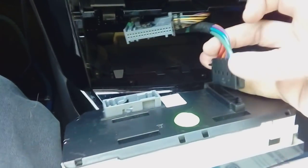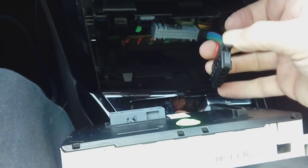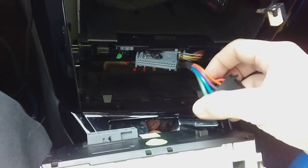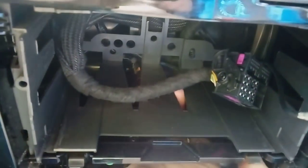The other connector is the power connector — squeeze the tabs together and pull it out. Worth noting: the large thick red wire on the end is an ignition-switched 12 volt, which could be handy depending on what you're fitting. Move that out of the way and as you can see, underneath you've now got a large area where you can get your hand right through to pull cabling down if you need the space.